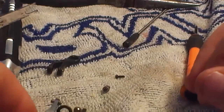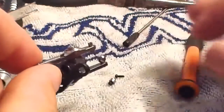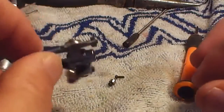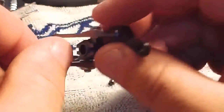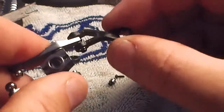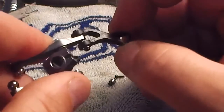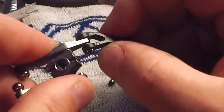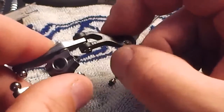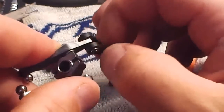So anyway guys, that's pretty much how I've solved this problem. So hopefully it helps someone out there with a loose washout assembly, because otherwise you get this sort of carry on, and that transfers quite a lot through the gear, and that's all it is, the little splines come out, and if you chatter away like that, it'll just wear it out. So you're better off fixing it before it gets too bad.